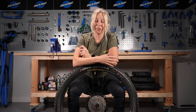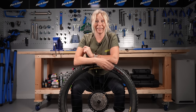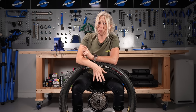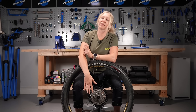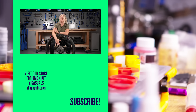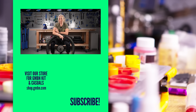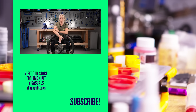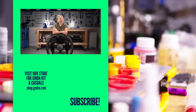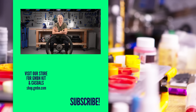You should be all good to go now - just put your wheel back in your bike and check that your gears work. If your gears aren't working great after you've put a new cassette on, it might be that your old chain has meshed with the old cassette and you might need to put a new chain on. Check out our other videos which should give you an understanding of how to fix your gears and troubleshoot any problems. If you found that helpful, give us a thumbs up and subscribe if you want to see more maintenance tips like this in the future.